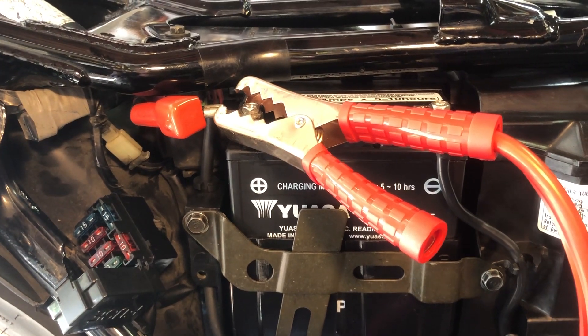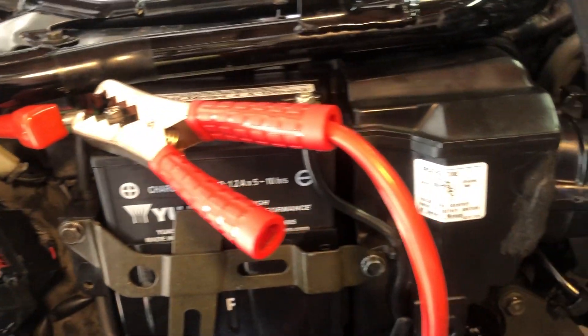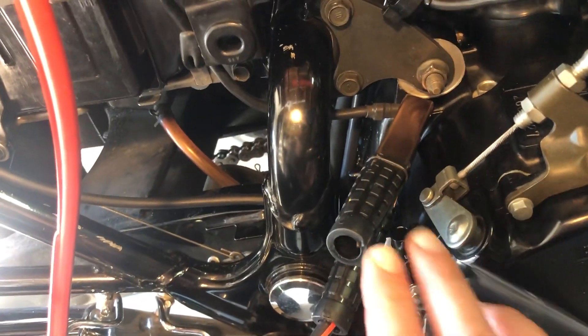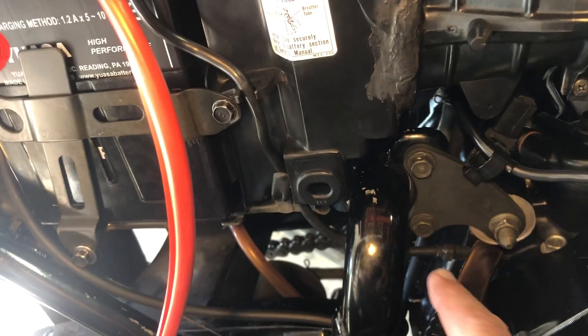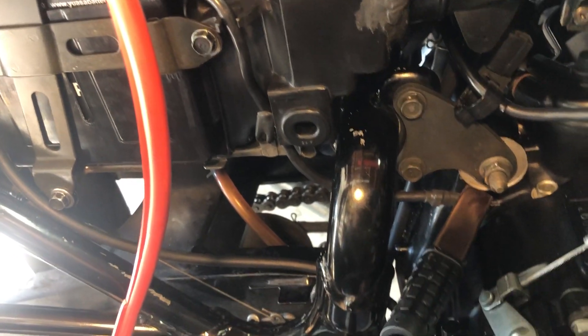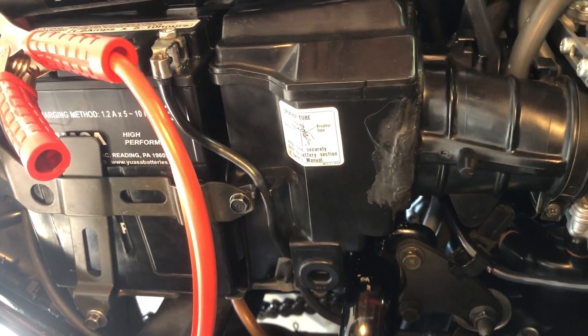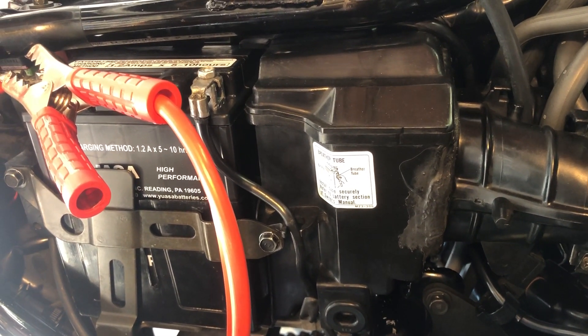Positive terminal of the car battery to the positive terminal of the motorcycle battery, and then the negative terminal of the car battery is connected to the ground on the bike. If you just follow the negative cable down to where it connects to ground, you hook the clamp at the ground position — I do that to avoid the possibility of generating spark right next to the battery.